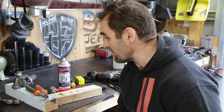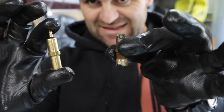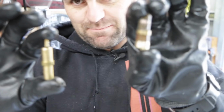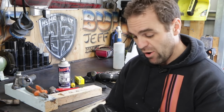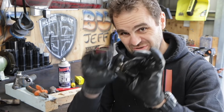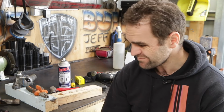All right, that was a pig trying to get that sensor out. Basically, that is what the new sensor looks like. That is what's left of the old sensor. Basically, the issue is it's just a press fit into the housing, but there's no way to grab hold of it, and it's hollow, basically. I mean, I ended up mangling it. It has a flat base on it, but there's nothing much inside of it. And trying to grab hold of it, I couldn't grab hold of it, I was just crushing it.